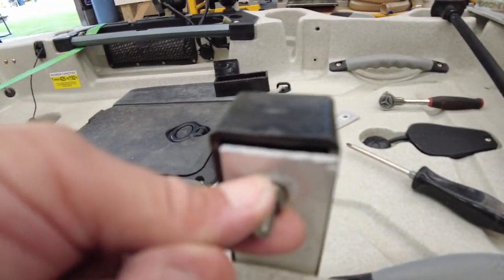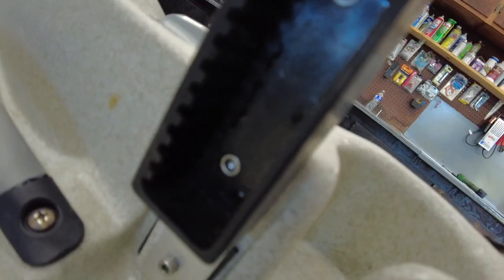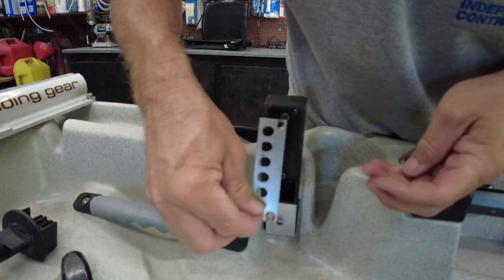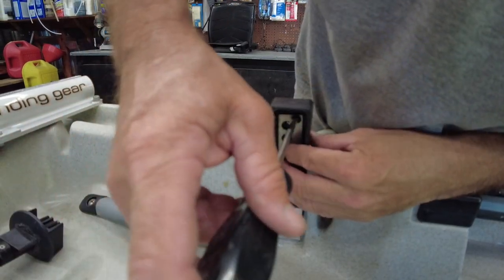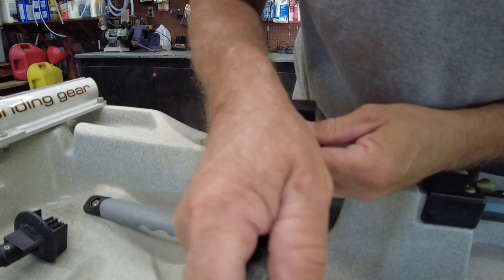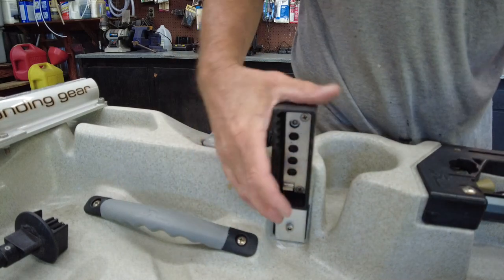Let me give you some close-ups here. I've got the new bolt here that I added on top — it's just lined up. You can see on the bottom there's the plastic washer behind it, a stock bolt in the original location, and a stock bolt in that location as well. Now we're going to put this plate back in — this is the actual adjuster plate. Use these screws; it's snug but doesn't have to be super tight because it is plastic. If you go crazy on it you'll end up splitting the plastic. That piece is back in place so this side's ready to go.